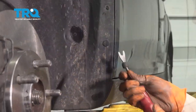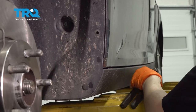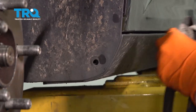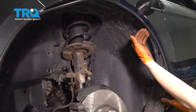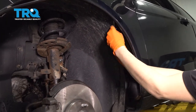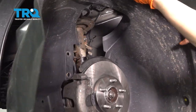This one came out — save that, that's what it's supposed to do. Last one — that one came out as well. Now you can grab your fender liner and remove it. It's tucked in behind the fender, so that's the only thing holding it on is just the pressure of the fender. Pull it down — and there it is.